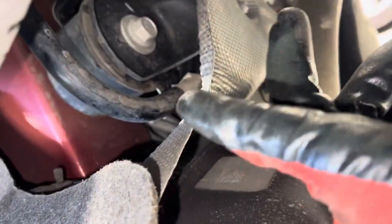The muffler is right here — let me back up. There's the muffler, and they've got those refrigerant lines running within inches of it. They also have heater hoses and metal lines right next to the suction line, which radiate heat — that's not ideal. But they put this plate here to stop that radiant heat all along, with that shield. It's not perfect, but remember they engineer to a price point.